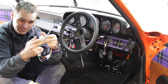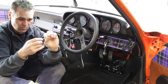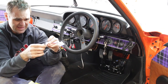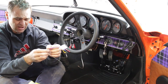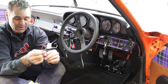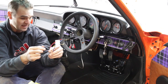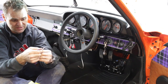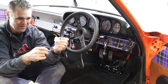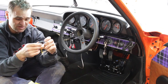The grey and white are the front speakers, purple and green are the rear speakers — they're usually something along those lines. With the power, black is always your ground, and then you've got red and yellow: one is always a constant 12-volt power and the other is the switched power on the accessories. In this case the yellow is the constant 12-volt power. The blue wires are for power antennas and turning the amp on — I have neither of those, so they're not necessary for mine.